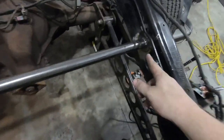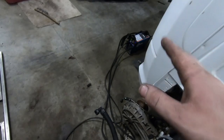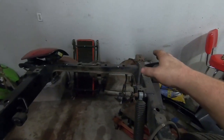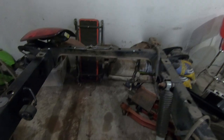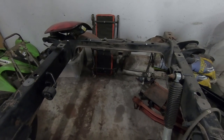I'd say that's sufficient, that'll work. I got those burned in — definitely a little getting used to with this 120 machine. Had to set it up a little hotter than I normally run it, but that's probably just because of what it is. The thing is amazing — it's completely silent until you start welding and the gas comes right in as soon as you touch that tungsten. That was something that was worrying me but it's awesome. Everything's solid. Now I'm going to move to the back, cut that cross member out. I have the hitch on so I can slide it off when we're done to see if anything tried to spring — I don't expect it to, but that's one reason I wanted to get this in before cutting that cross member out. We'll get to mocking up our fuel cell — I think it's better to weld that in before we do that little cross member in the back.